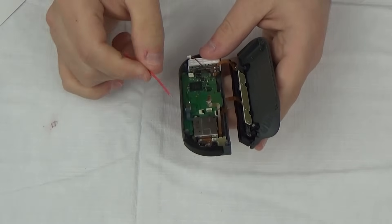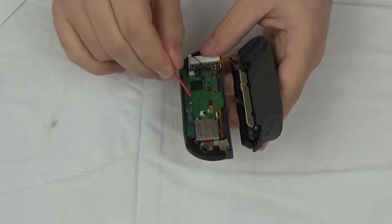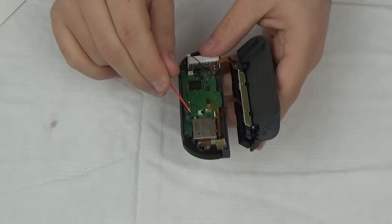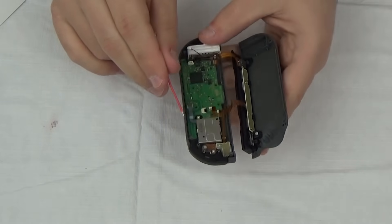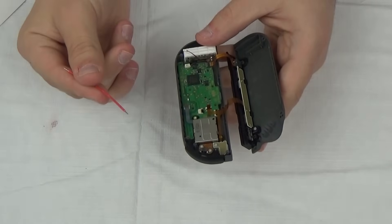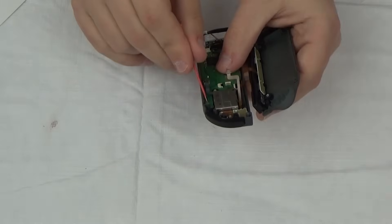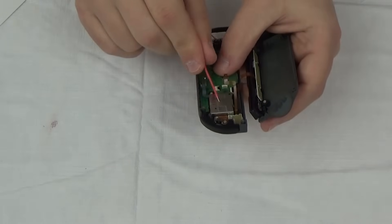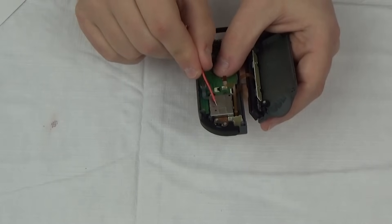Looking at this right away, I think the reason is because the antenna is built into the board, like I talked about in the last video — it goes from here up, and at the top there is an actual antenna etched into the PCB. Some devices do that, like PS4 and PS3 controllers, and that's fine. But in this case, it's sitting right next to a very large metal box that is behind the Joy-Con.